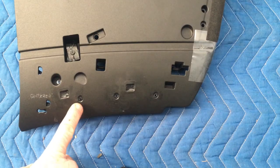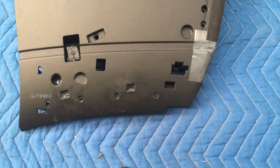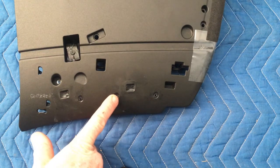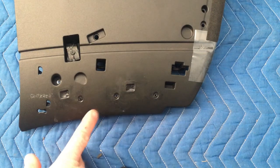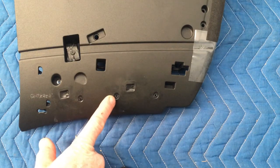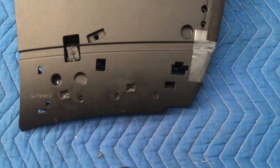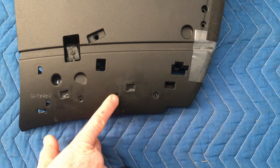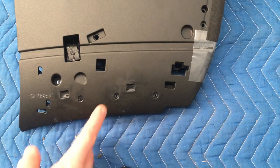On each side, this is where those rivets would normally come through. I put a 4mm nut in there. It actually needed to be ground to fit in that slot nicely, and on the edge here, so it doesn't protrude into the canvas once everything's put together. Once they're in there, I've just used some glue. It's actually just a rubber sealant to hold those in place. So everything's nice and flush, so when the canvas is on, it's not going to stick out. And I'm going to use screws that are only just long enough to protrude into the nut and not end up being a problem and sticking up.